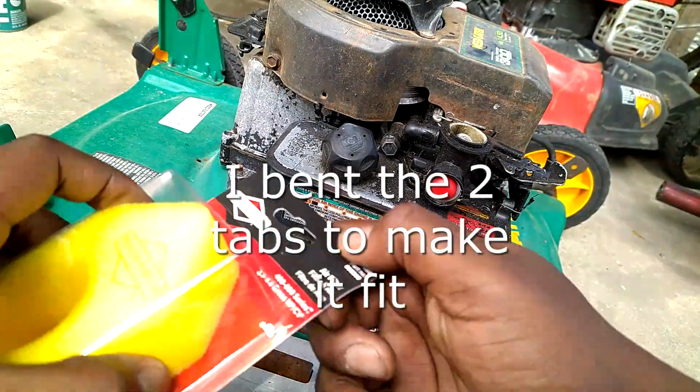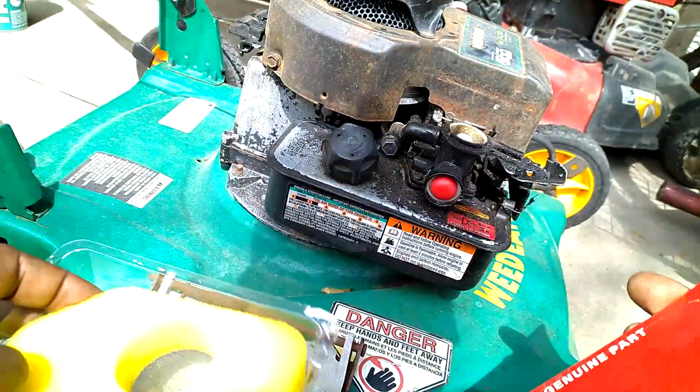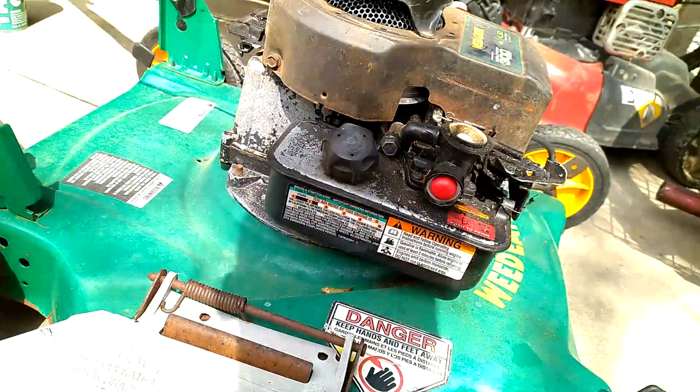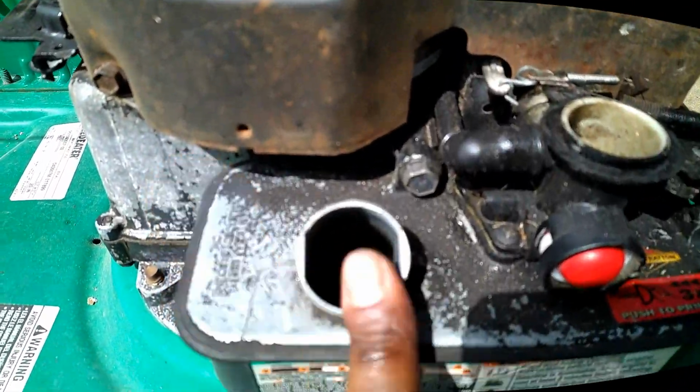These mowers, you can't really do, I apologize about the wind, guys, but these mowers, you can't really do a no filter run on these like I normally do. Okay, now we're gonna clean the gas tank. There's garbage in there. There you go. So I'm going to clean the tank. There's also some white milky stuff in there. And we're going to clean the carb.